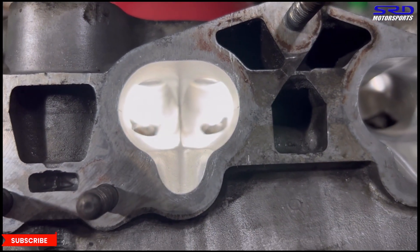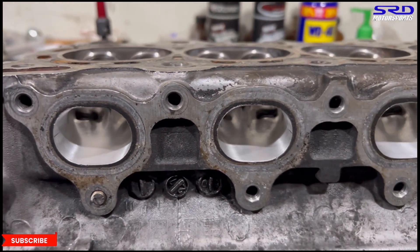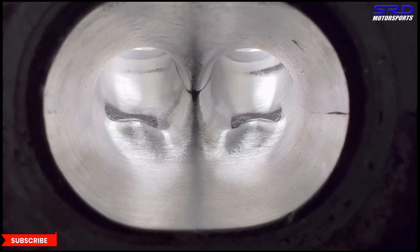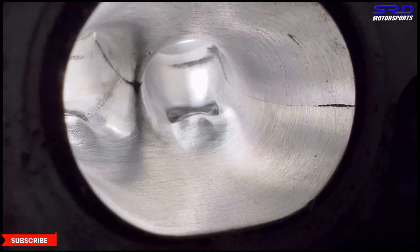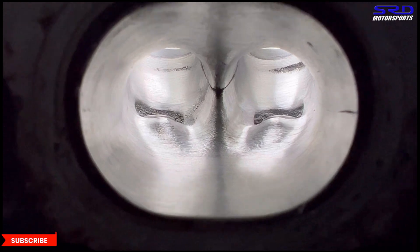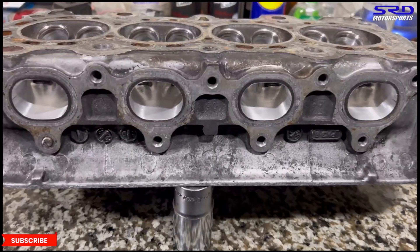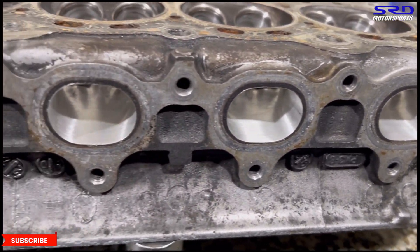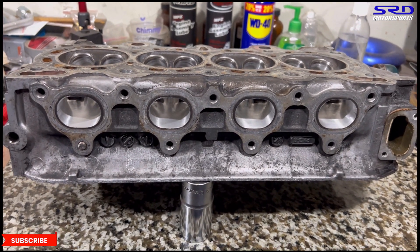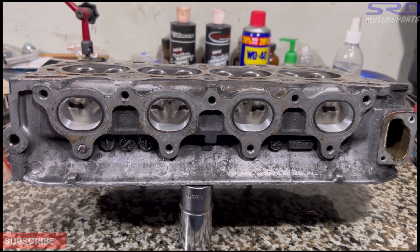Now let's look at the exhaust — 120 grit finish, really good right now. It's not totally hogged out. It looks really, really good. You can still see the core shift is still there, but we didn't totally remove it because it would skew or make the shape all weird and wrong. So we just continued to port the exhaust as well as we can and as round as we can so it's flowing really well. We still have no specific application for this head, so we ported it quite mild. But if you want to check out a more extensive PM3 head build, the link to the series of my own build is going to be in the description and pinned in the comments below.